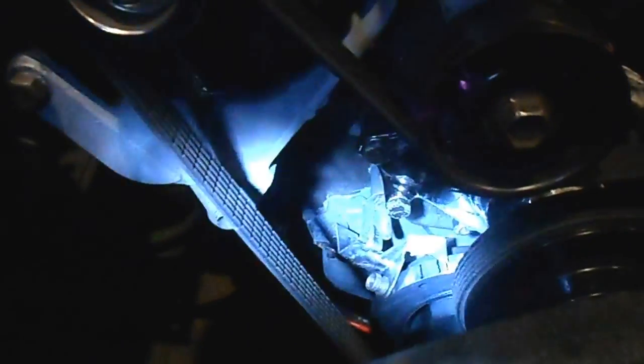Just turn your distributor — let's see what we got here. Yeah, that's about 14 degrees right there. That's about 15 — kind of pushing the limit, but it's got a few add-ons on this car. There we go.